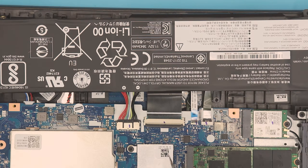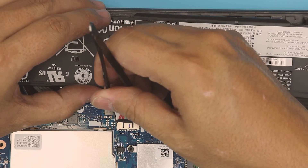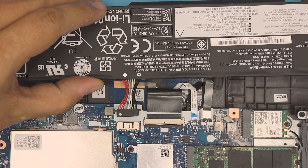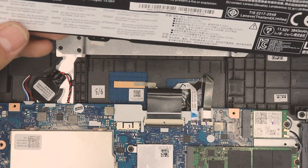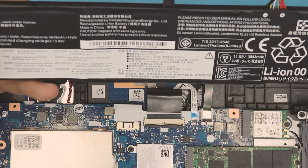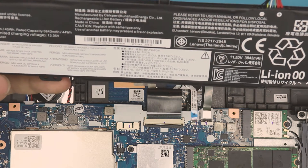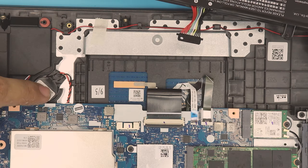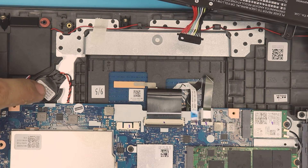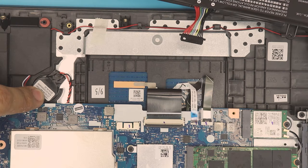There it is. If you pay attention, there's a tiny space right there on the jack. What you want to do is pull it backward — just like that. The model number for this battery is L18C3PF1 — I'll leave a link in the description. Also visible here is the CMOS battery, which holds the configuration, date, and time for your BIOS. There's a tiny jack there; you can purchase this one too — the part number is visible on screen. This one lasts about five to six years, so you don't need to change it right now.